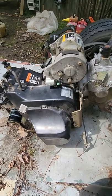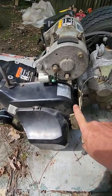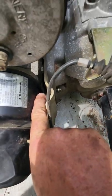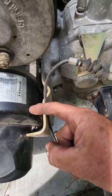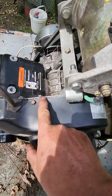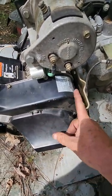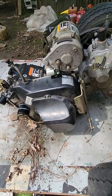A lot of times when you're pulling these motors, these covers right here — a lot of people get in here and think it's not coming off because it's way down in here. On this unit, about where my finger's at, on the older style there's a cover and it's got a nut and bolt to go through it. What I do is on the back side, once the cover comes off, I want you to imagine this being around the corner — we notch it, so when the cover comes off it'll slide in and you can tighten it up. Some of the newer covers don't even come with the actual hole before you put the nut through, and that's fine.